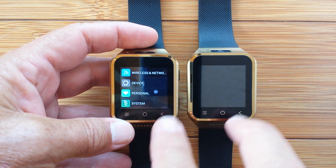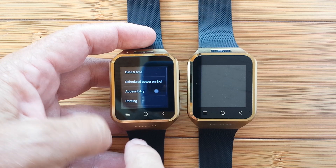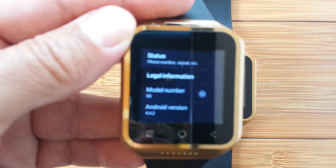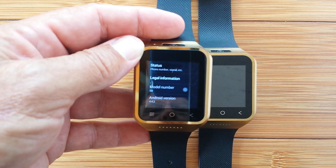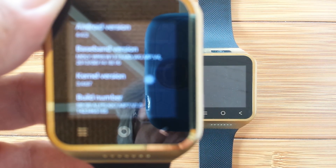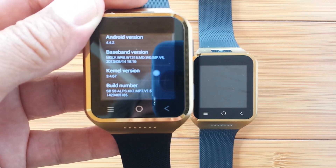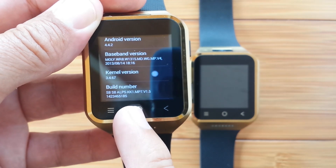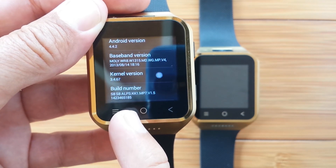There are going to be more of these Android-based watches. The first thing you want to do is go into the System icon, go into System, scroll down to the bottom, and click on About Phone. There you get a bunch of information pertinent to your unit. Scroll down to the bottom and look at the build number. That is the information that relates to the firmware for this particular unit. This watch is the newer watch, and the build number is higher. If your build number is higher than this number, you have an even newer version.